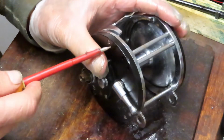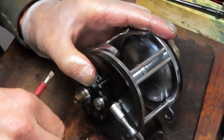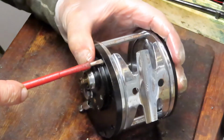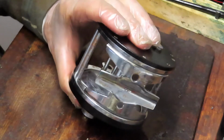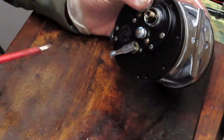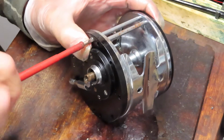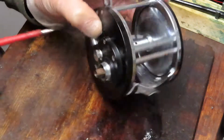And I've been asked, does it matter if you use a mechanical screwdriver, something like this? Certainly there's a lot of screws in here. On the outbound side, not too much cause for concern there, but on the inbound side, when you're putting them back in, I don't recommend it. What I do recommend, if you don't have the hand strength to do that, is to do a short. In other words, tighten it up with your mechanical screwdriver, but don't tighten it all the way. Leave it short, and then do the last turn or two by hand. That way you won't risk breaking a case or over tightening the assembly.